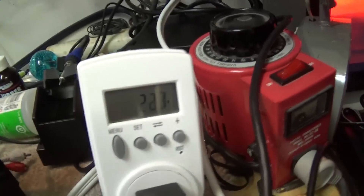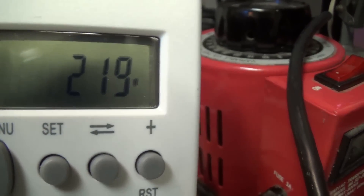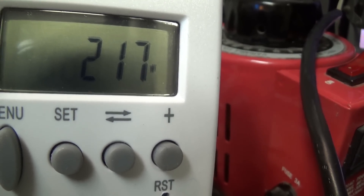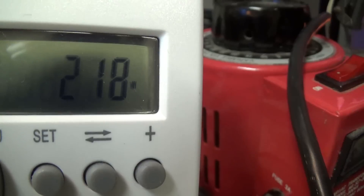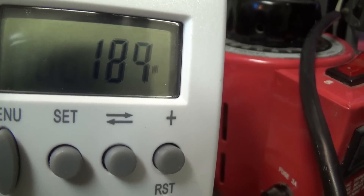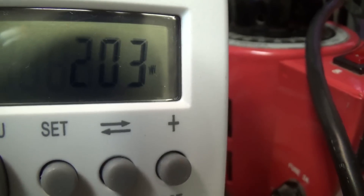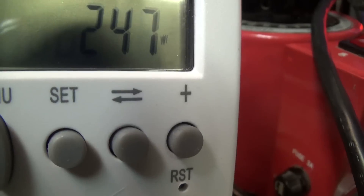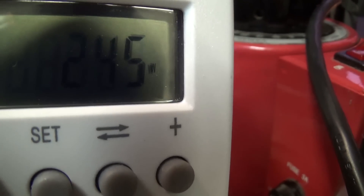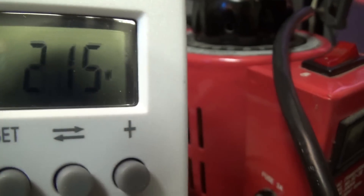The plasma behind is now playing and it's drawing on average about 220 to 230 watts. Again, power draw varies with screen content, averaging around 220 watts. This is a 10-year-old 40-inch plasma. A white screen would probably be around 350 watts, but I can't test that — this set only has RGB and DVI, no HDMI. In real-world use, it draws around 220 watts average.